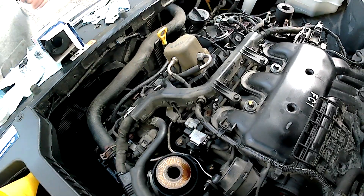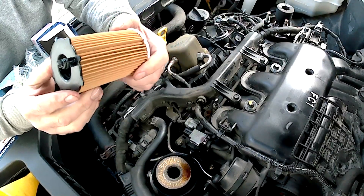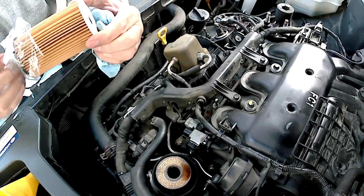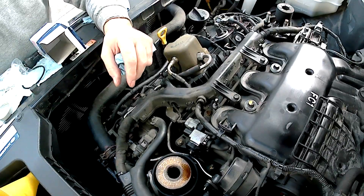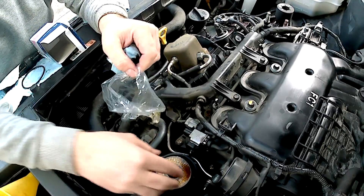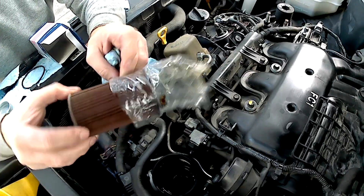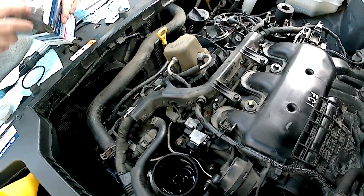Pop out the old filter. Before I do that, there's another O-ring I'm going to want to pre-lubricate, right here on the bottom of this filter housing — it has a little protrusion. The oil in that bag is still clean, just wipe it around there and that's ready to go in. This bag also serves one other purpose: wiggle up the old oil filter, make sure that O-ring is still installed on it — you don't want to leave it down in there. Put it in that bag so you just throw it away with the box it came in.